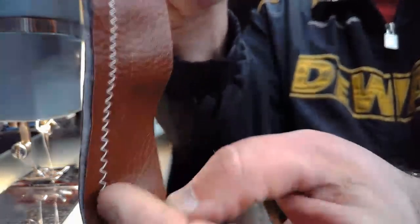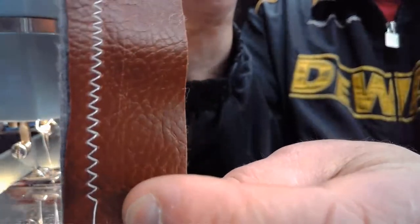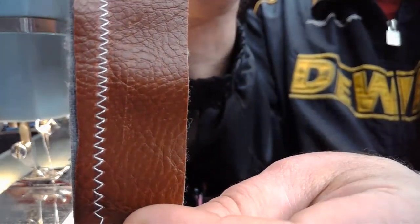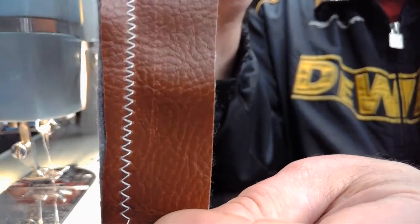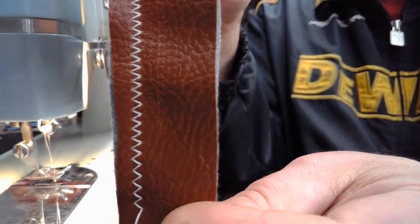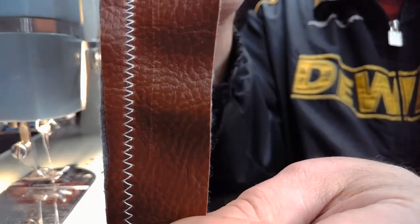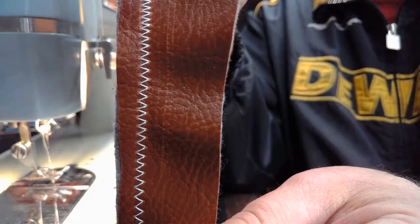Turn it over. Is there a lock stitch? The lock stitch is actually, I would give this a higher rating than our top stitch. The machine managed it a little bit easier, but that makes sense because when it's laying down the top stitch, the movement of that material is going to have a bigger effect than on the bottom.